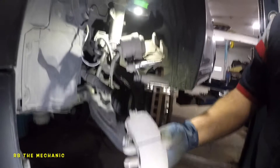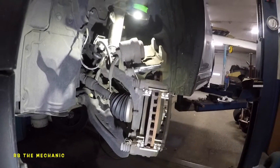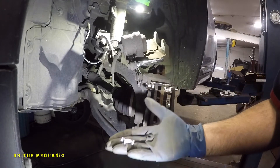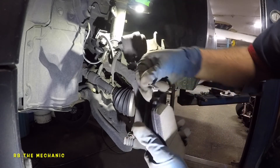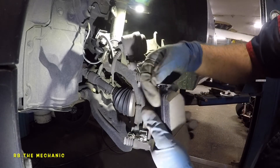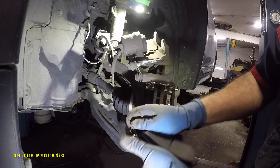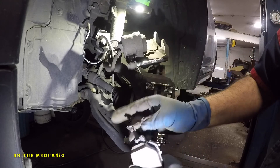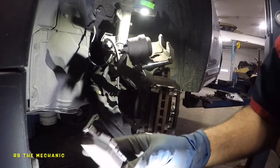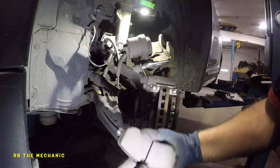The next step: we're going to put the little brake wear indicator sensor on this brake pad. The little sensor goes on the top, and it's going to go in this way — you cannot put it the other way, because if you put it that way it's going to hit your disc. Try to get it seated the same correct way. All I did was squeeze the little retainer because it was sitting too loosely in there.